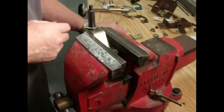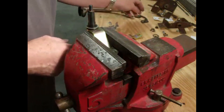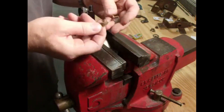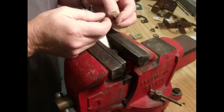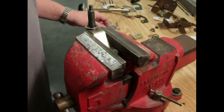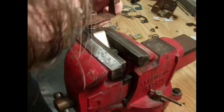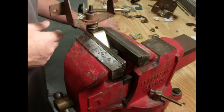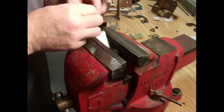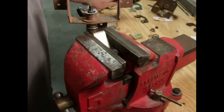Then use one of the large diameter washers and put it over the spring washer. Then put on one of the new bearings made out of Delrin. Most of the old bearings we find in old shifters look worn after 50 years — normal wear and tear — so we provide new ones. Then take your shifter body and slide it over and into the bushing. Take the next bushing, put that in — it tightens things up a little — and then put on the second washer.